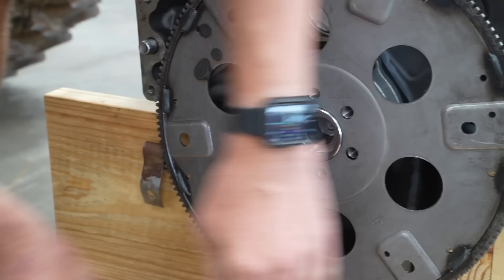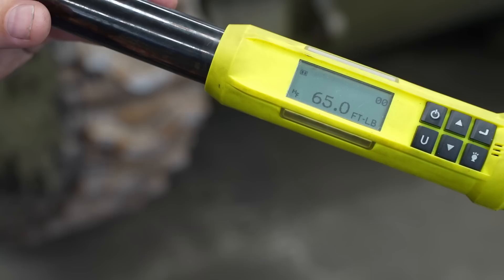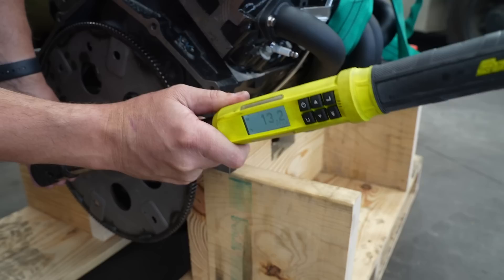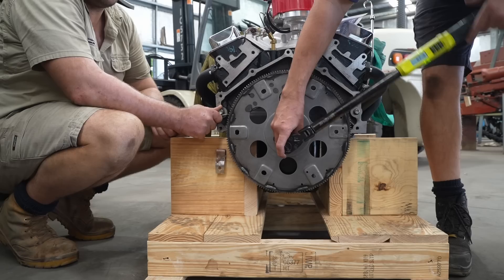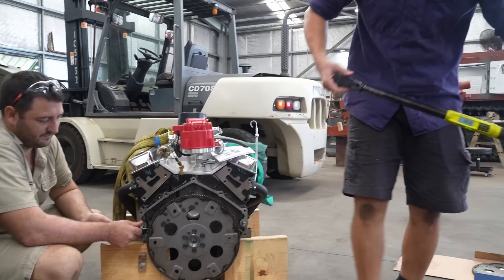Ryan has brought a lot of cool gear with him when he started work with us, like this torque wrench. With this he can tighten the bolts to as close to the manufacturer's standard as possible. We're targeting 65 foot-pounds, but I'm not going to go to 65 straight away — I'm going to go around in a cross pattern and get them snug first. You can see the torque I'm putting on now is around 24 pounds and we want to be at 65. So we're not torquing this up fully yet.